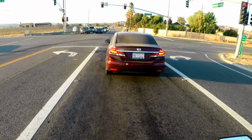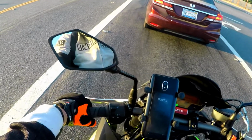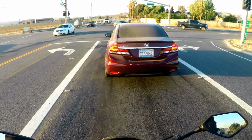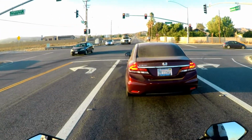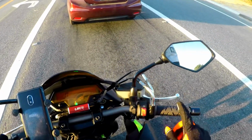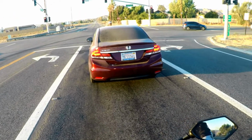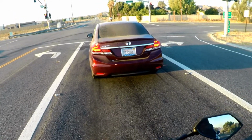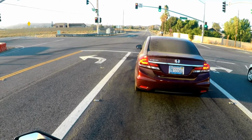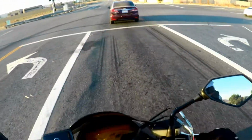Okay, be very careful when you do it. But if I'm going straight and I pull back on the left-hand handlebar, we're going to veer into the right lane. You don't pull back a lot, just a slight pressure back. Pulling back on the left and slightly pushing forward on the right will lean me into the right lane. Likewise, pulling back on the right handlebar and slightly pushing forward at the same time on the left handlebar will make us go into the left lane.